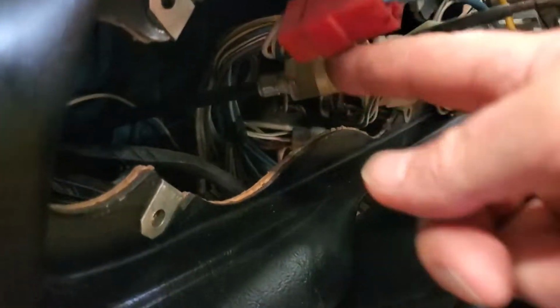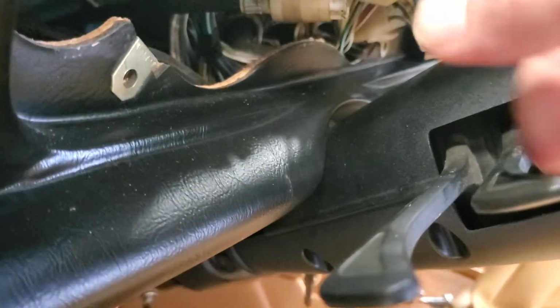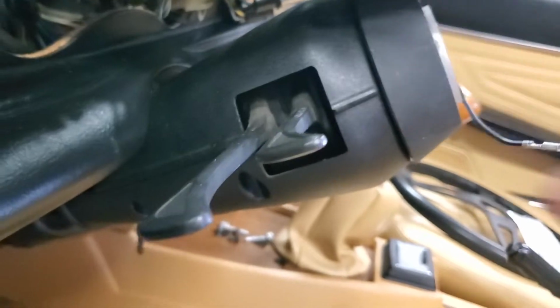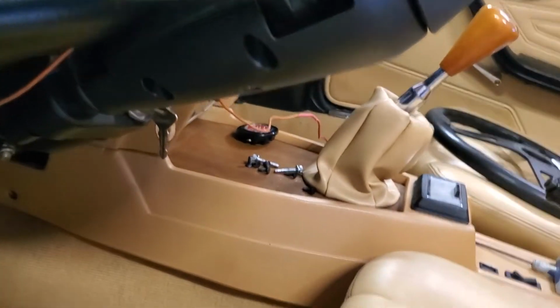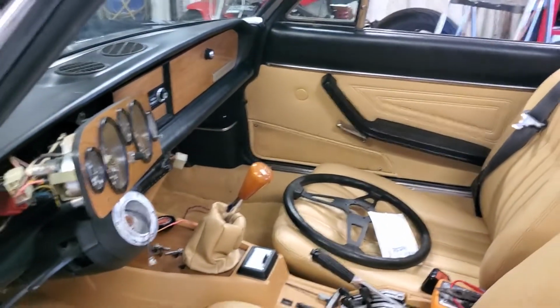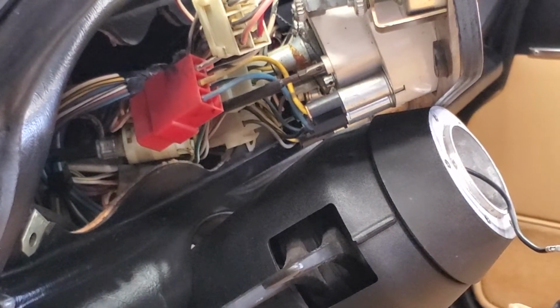So the speedometer cable pulls out from the firewall and it's going to plug into right here, and then we're going to push it back slow and I'm going to pull as I'm pushing so that I don't break it. Well, I don't think there's anywhere to put the camera to film this. Hold on. I can put y'all right there.